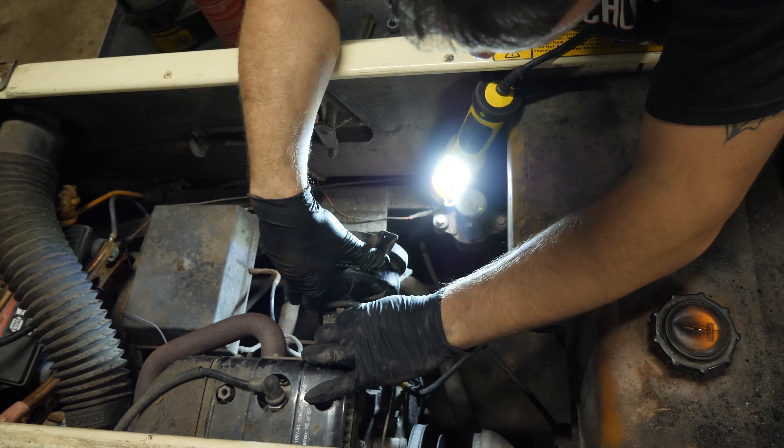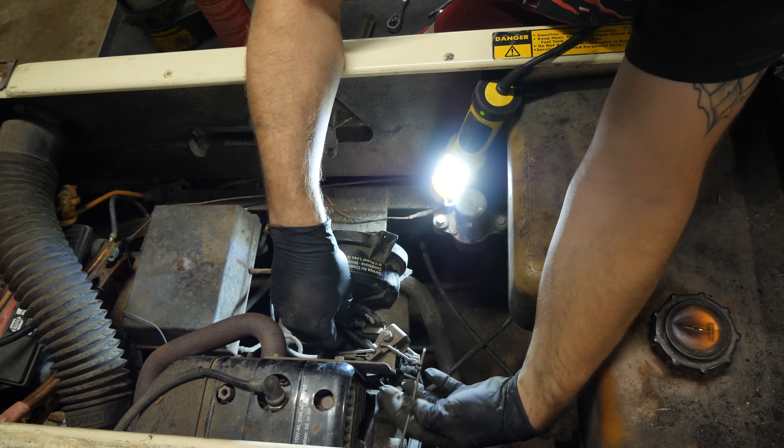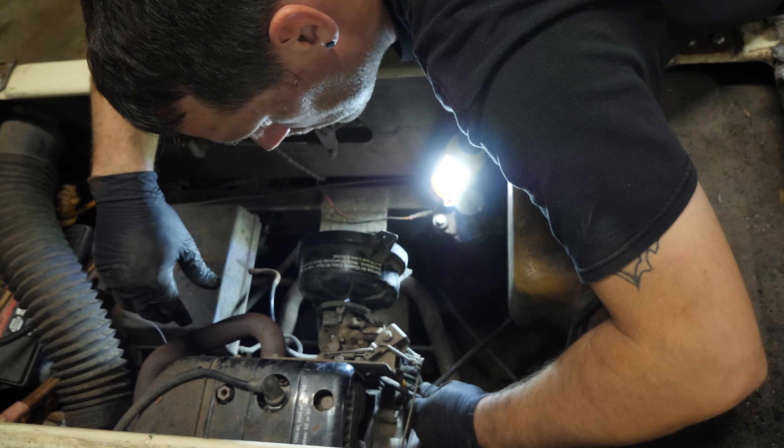We're basically freed from that. The air box is held on by some other hardware. I'm gonna move the throttle cable out of the way. This is the breather tube. There's a bracket on the bottom that holds the air cleaner on — you don't really have to take it off. If you bend it back out of the way you can get the carburetor off, no trouble. So now I'm gonna pry up here — it's just clipped in. Take that control off, remove the spring, and drop it on the ground. That's how you know you're doing it right.